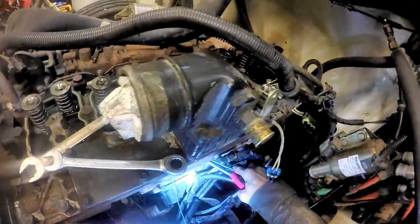You want them tighter than hell. I don't know if it makes much difference, but I'm lifting them up and spraying a little brake clean on them to try to dry them out and get the oil off of them. Alright guys, so all our lifters are held up with zip ties. Hopefully they don't fall through. I've had very good luck with that method in the past.